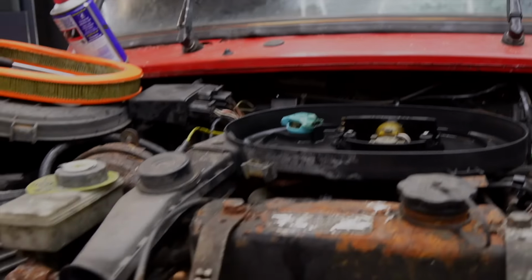So guys, right underneath the engine here, I can see a little rubber bung. It's got a nipple off the engine and it's just a rubber bung on the top. And it's got a jubilee clip. I can see that jubilee clip is completely rusted off and the rubber bung's got a big hole in it. And when you put water in it, I can see that's where all the water is coming up from. You're not gonna be able to see it in there, but that's where it's coming from.